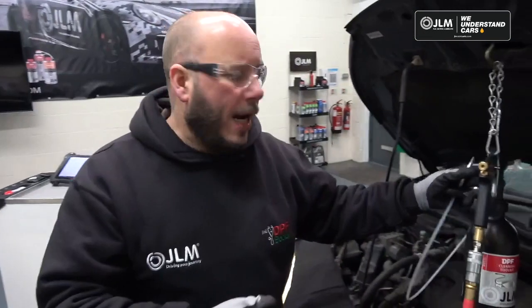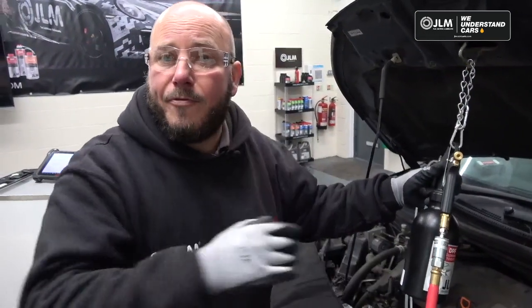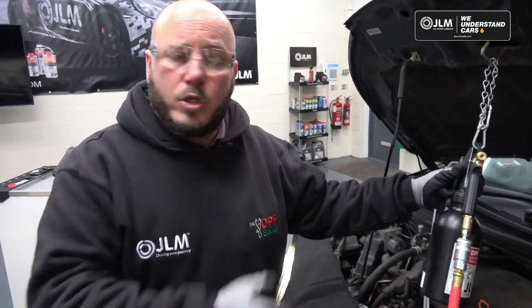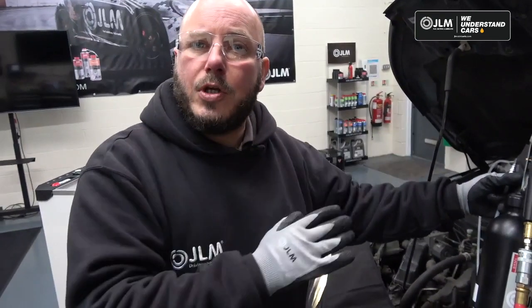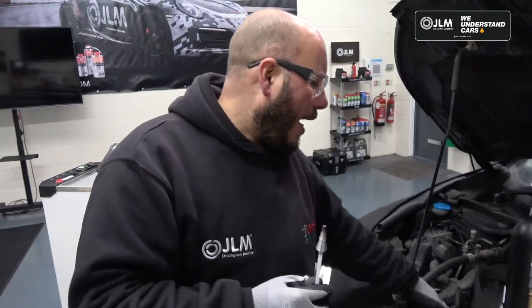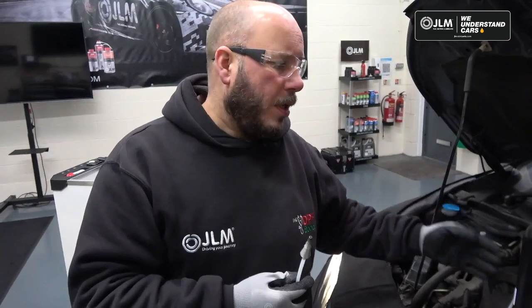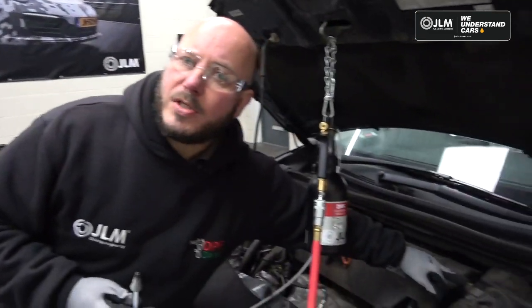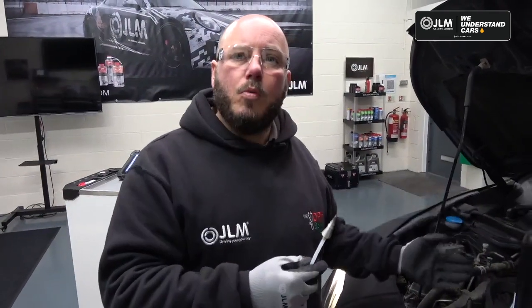What we're left to do now is we must fill this canister with water and flush it into a bucket. That's just to protect the seals on the toolkit. So we'll do that now while the engine is still on fast idle, and that will allow any chemical to disperse from this pipe, and then we'll come back, we'll reconnect the pipe. We've also reconnected our mass airflow meter. So we'll clean that out, we'll reconnect everything, we'll go for a 20-minute drive.